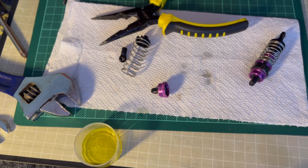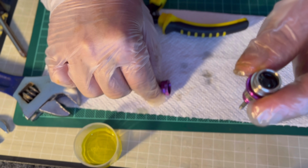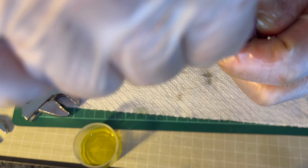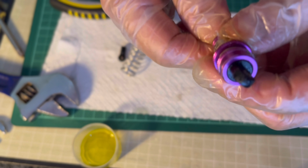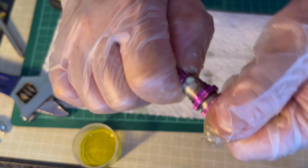You can see at the bottom if there's a leak. In this case, there's no leak, so I can put back now the shock cup, the upper part cup here, to seal this part of the RC, so that the shock oil won't leak. Right, so oil is there now. If you can see, there's no leak. Even if you push it up and down, it's not leaking on top and bottom.